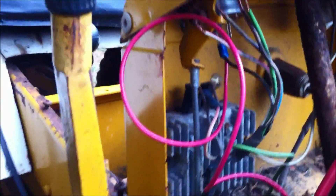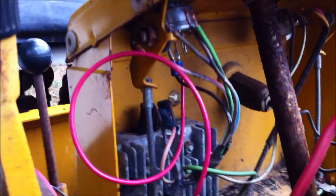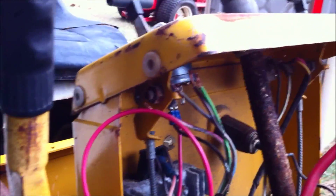Why would someone hook a ground wire to the S terminal? The S terminal was hooked up to the I terminal for ignition. So for now I basically crimped some ends on there, made some makeshift wires. I'm gonna hook up my booster pack to it and hit the key to at least get the starter to turn over, then we'll trace the wires for the ignition module next.